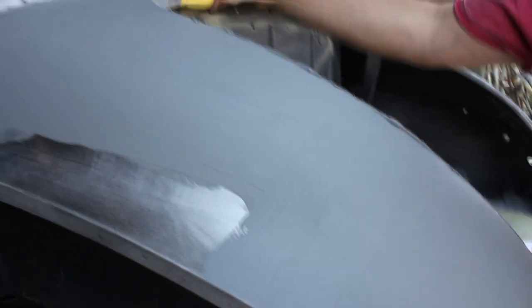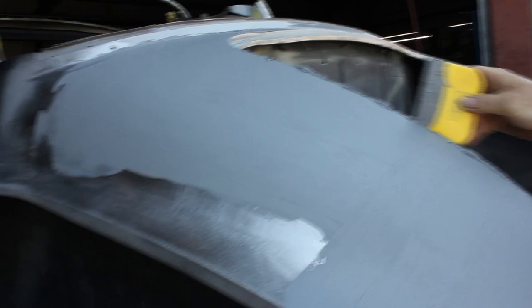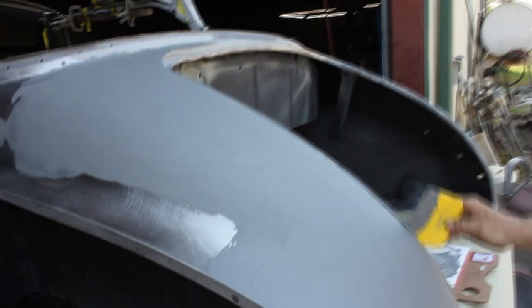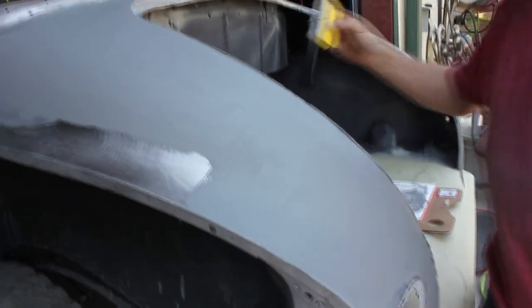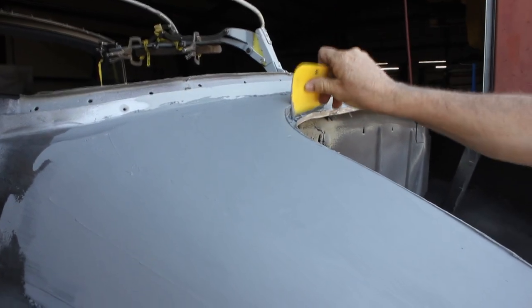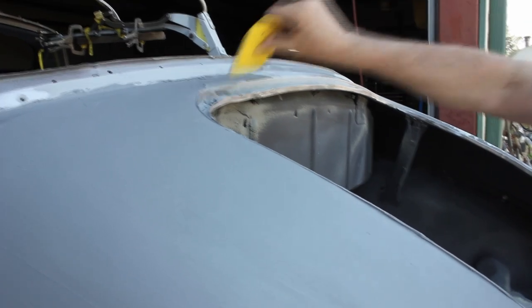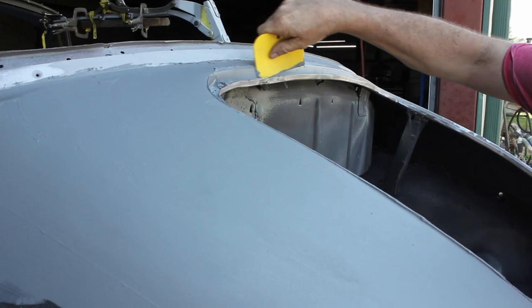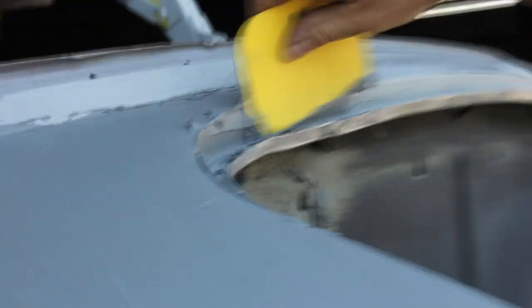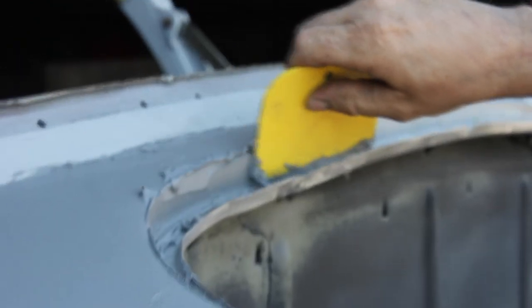I'm going right along this lip, right on the inside, just to smooth that edge — it's going to end up being paper thin when I remove everything. This area on Chevys was all lead, all the way around this edge and this part of the car. A lot of your 30s and 40s cars were all filled in with lead around the gaps. I've used lead for years — if you do it the right way it is very good, but it is a lot more work. An aggressive amount of time doing lead work.